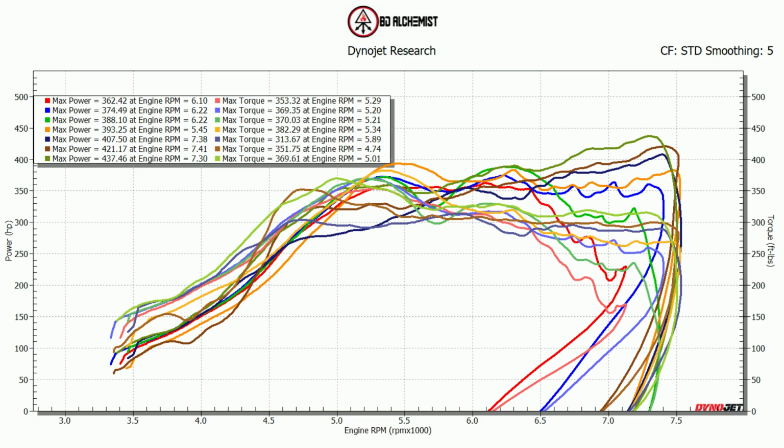We're really not going to push it here since he's getting a flex fuel tune. So this is on 24, 25 pounds of boost. Really no timing, and still in the high tens up top AFR. And I think this is good for 93, because he is going to go full E85. But this setup will produce 500 on 93 pretty easily as well.